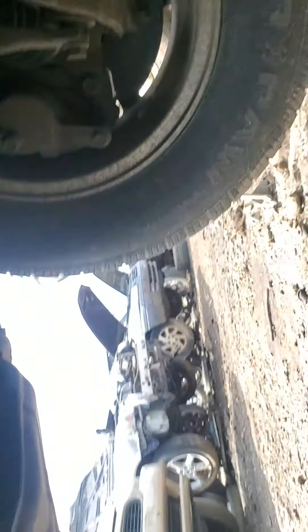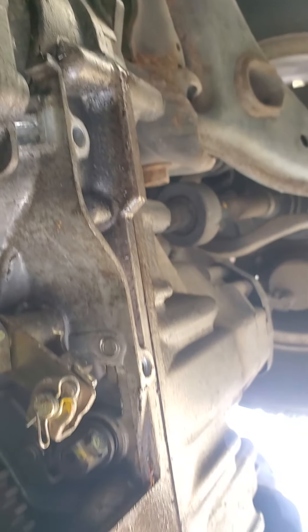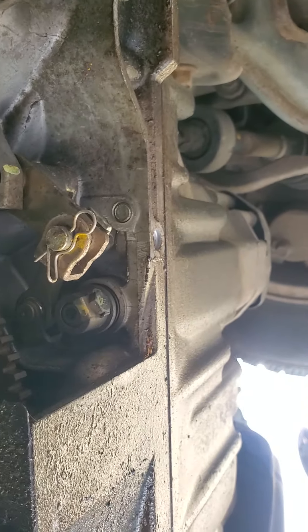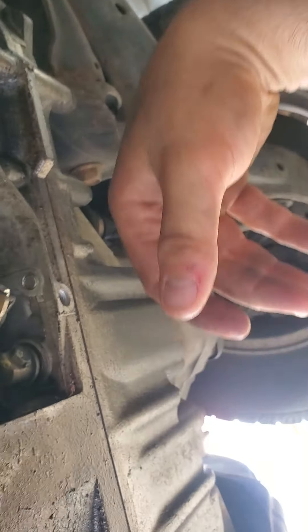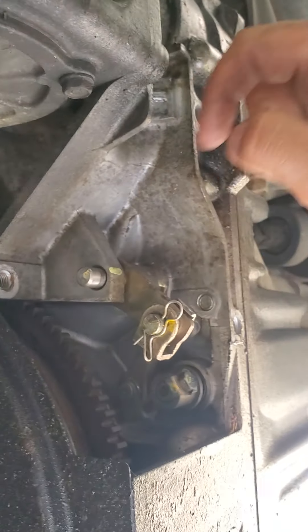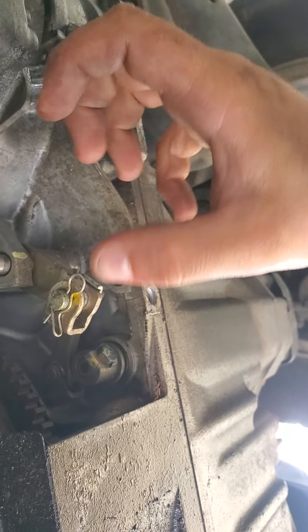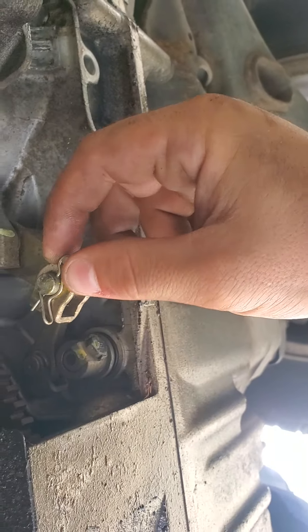But anyway, you come down here. There's plenty of videos on how to mess with these online, but — oh, it just got leaked right in my face. Oil to the face, that's awesome. Good thing it didn't go in my eye, that would suck. Anyway, 12mm bolts — one here, one here, and one here. So after you do that, this plate comes off, and you have access to your shifter cable. It's held here by this little cotter pin.